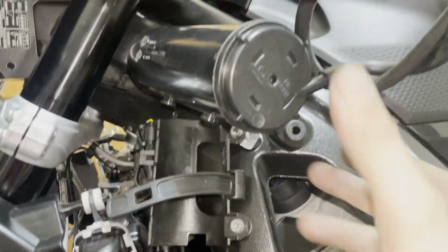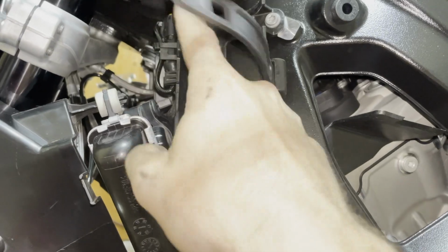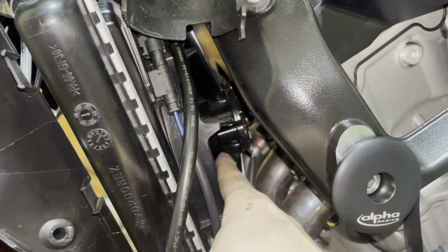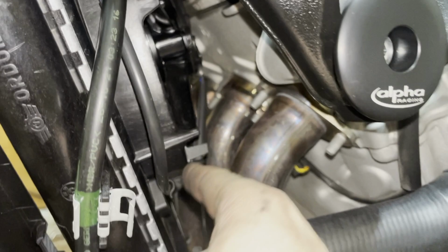All right, here on the other side, I have the charcoal canister just on its cable hanging out. It's usually in this, so you just take it out. I'm gonna remove those 2 brackets, so I have a little bit more access here. Here's the fan. I got all but 1 screw already out. That one is the last one.